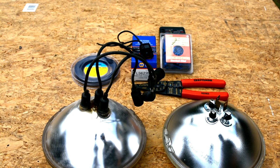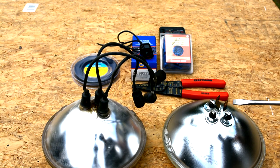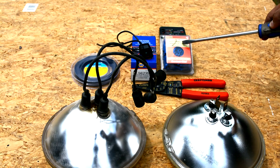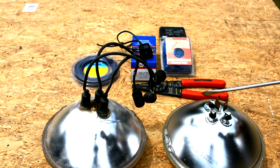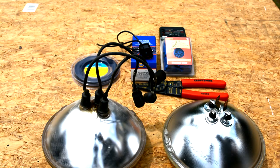Here's an overview of everything we're going to use today. Here's the old headlight — we're going to use the plugs out the back of it. Here's the new headlight. Here's the actual plug we got from NAPA. We're going to finish everything nicely with some 16 to 14 gauge connectors, strippers and crimpers, and we're going to make sure everything's waterproof and watertight with black heat shrink tubing. Let's get started.